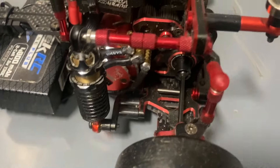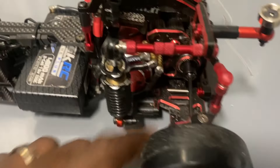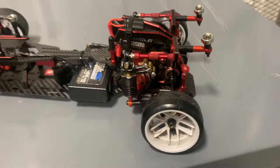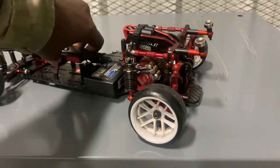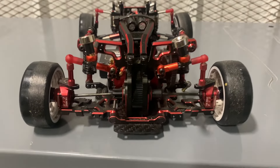Two standoffs here get the damper away from the arm, but it makes this require a stiffer spring. The closer the damper is to the arm, the less stiff the spring has to be. I learned that. It's pretty far away, as you can see — there's the arm itself and the damper is way up high. I learned that from the Rhino Racing Shark.